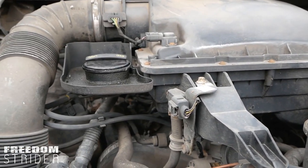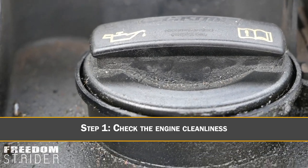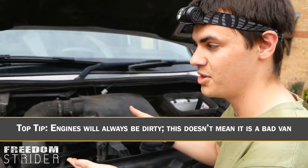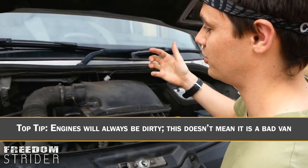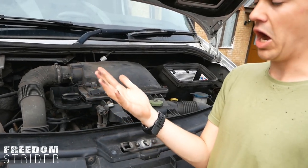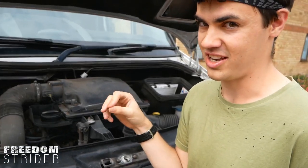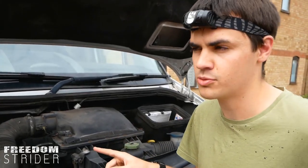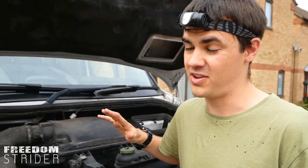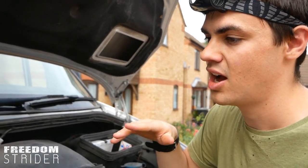The first thing to do when you open up the bonnet is just have a look at the engine. Like when you looked around the outside, just come in and have a look at the condition. It will be dirty and dusty because it's an engine and it's diesel. But if it's excessively dirty — like oil or very thick buildup — that's not a good sign, run away. Counterintuitively, if it is too clean, it might be hiding something. People don't generally clean their engine bays pristine, so a dead-clean engine may be concealing issues.